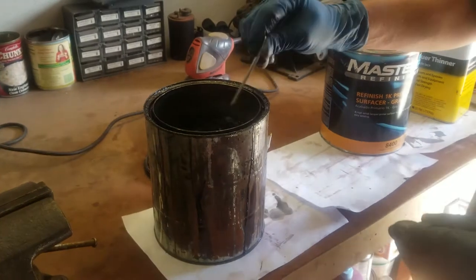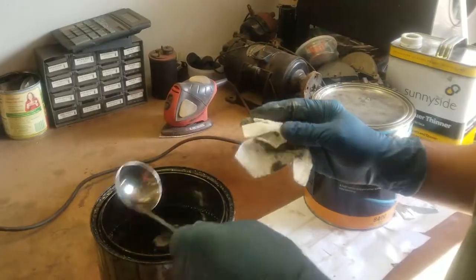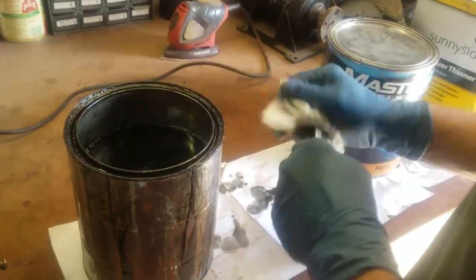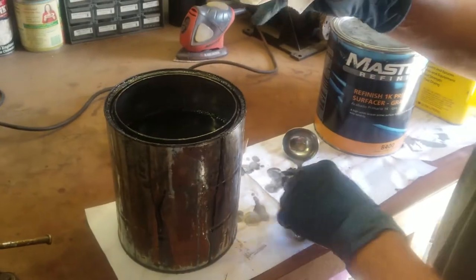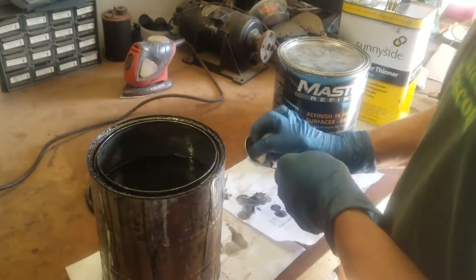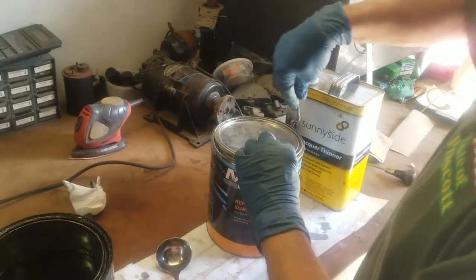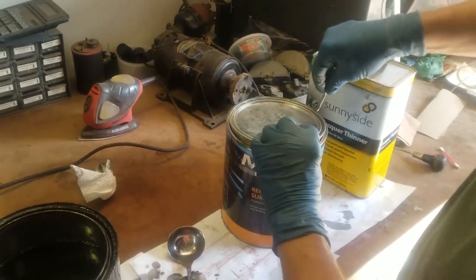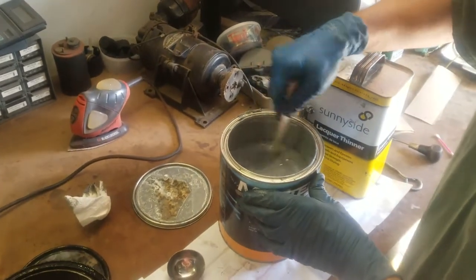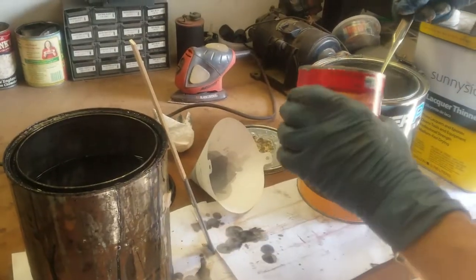Here you can see a dirty can of thinner and a stainless steel ladle I store in it — it's a great way to keep it clean and ready, with a place to dump it when you're done. If you buy a stainless steel ladle at the grocery store it'll probably outlast you, and it's the neatest way to measure. You don't need graduated measuring cups — you just count ladles. If you need a 50-50 mixture, it's one ladle of each. For a four-two-one mixture, which is used for spraying urethane on the outside of the car, it's just four ladles of color, two reducer, and one hardener.